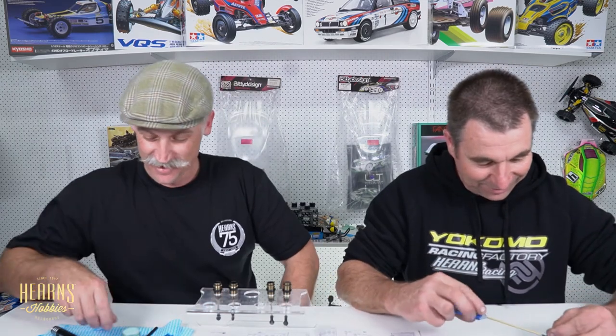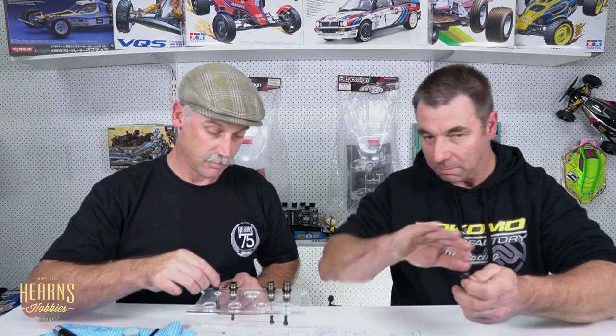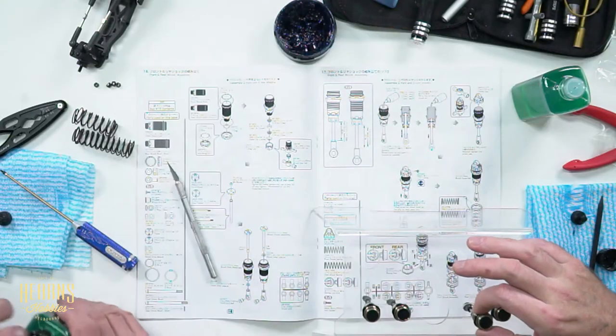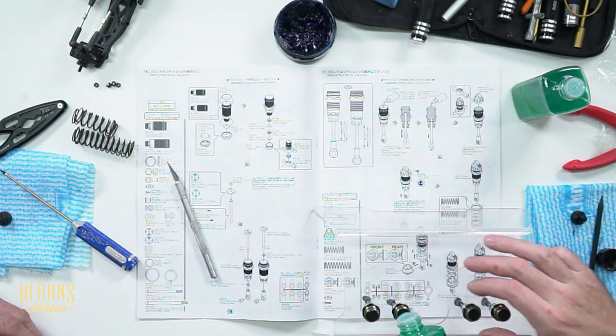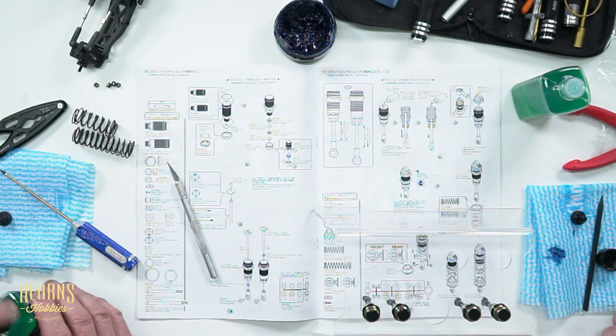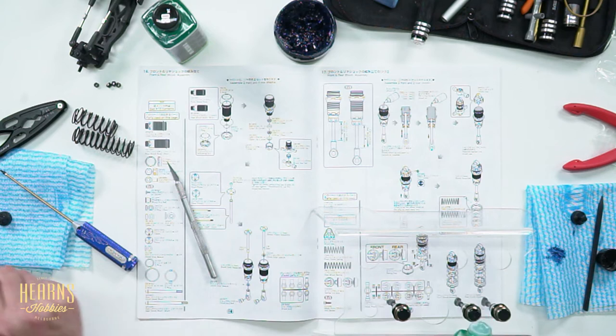Do you want me to start putting these caps on? Is there any air in the shock still? Is it still coming up? I want to say no. Have you made sure that they've got the right amount of oil? Because when these are brand new and they're dry inside, you'll need a mushroom of oil on the shock top. Do you understand? I've been known to put a few drops inside the cap before. I just get it right on the shock, filled to the brim. Watch me overfill it. Can I overfill it? Well, you're cleaning the crap up if you do.